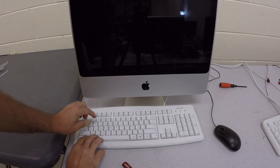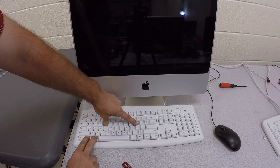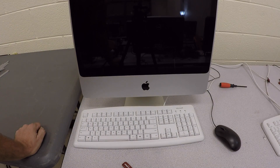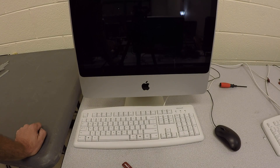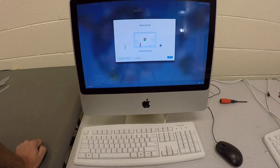Hold the Windows key + Alt + P + R (or Option + Command + P + R on a Mac) and boot the computer. You'll see it turn on and then turn back off and make another sound — this resets the PRAM so the logic board will accept the new SSD. When it boots up the second time, let go of the keys and the computer will boot into CloudReady. The computer starts really fast and within a few seconds you'll be in the new Chrome build. The computer is now ready to be used by students and teachers, and you've saved hundreds of dollars by spending just a few dollars on components.